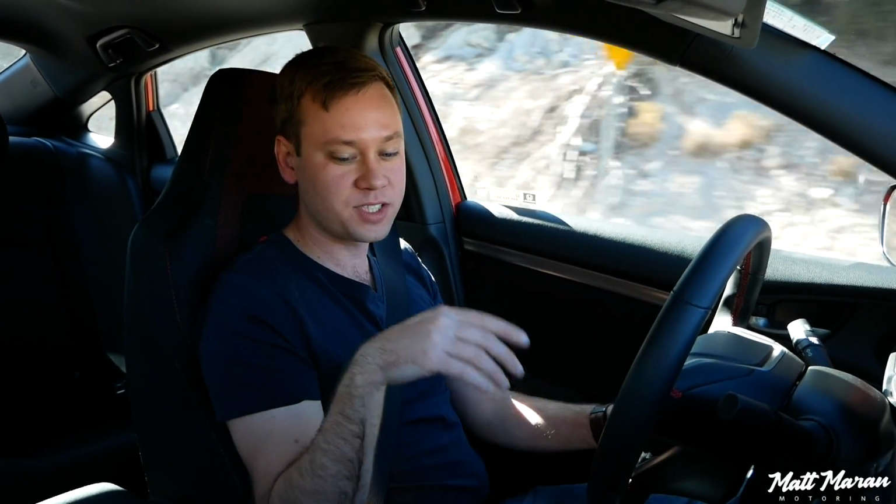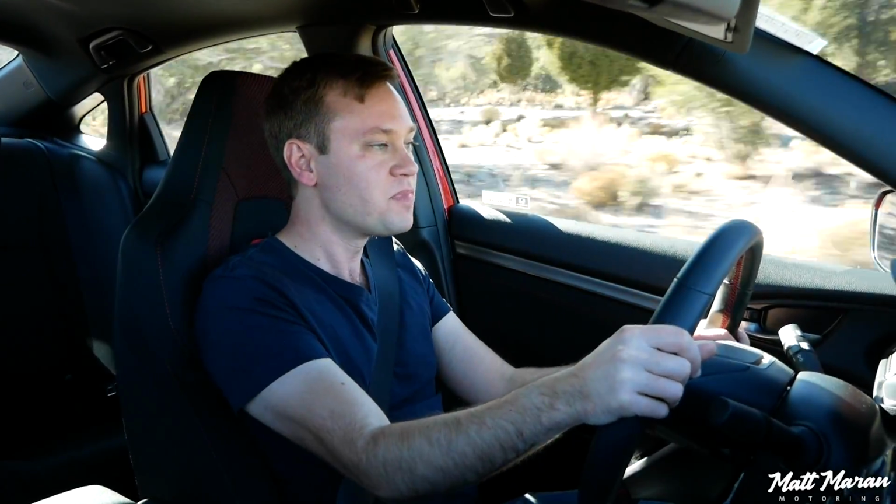They said that some customers didn't want to downshift to 5th, so you leave it in 6th, and you have all the passing power you need on the highway now. So that is nice. I personally don't mind downshifting, or they could have done something to have a shorter final drive but make 6th a little bit taller, so you have the increased peppiness but also the better highway cruising. But they just decided to do the final drive, which is a simpler solution, and I think it's fine as long as you don't mind fuel economy.